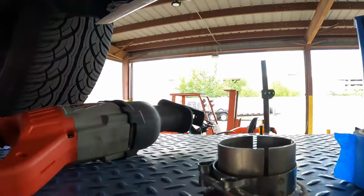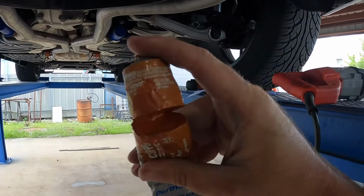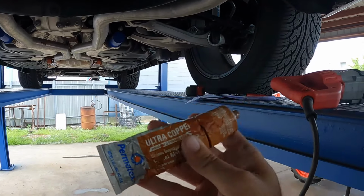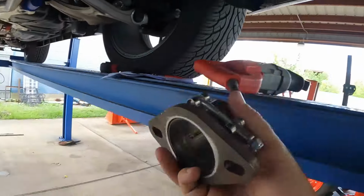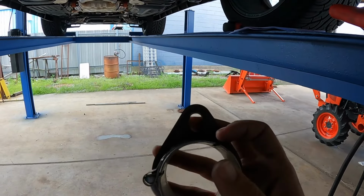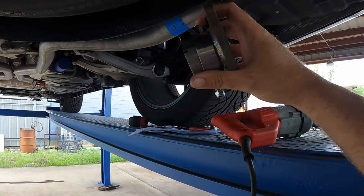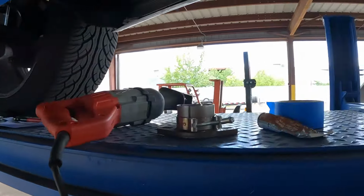And for your fitting, I like to use a high temp silicone. And here's the problem with mine. So I'll put a link in the description. I'm gonna run to the store and grab some. I always use it on these joints because these kind of leak. If you just put a little silicone in here and you slip it on, it'll give me enough time to make my adjustments, do everything I need to do. It'll cure and we'll have a leak-free exhaust. Off to the store.